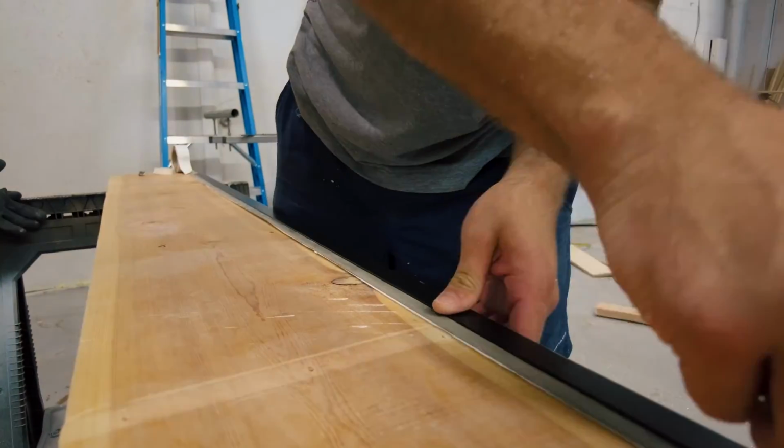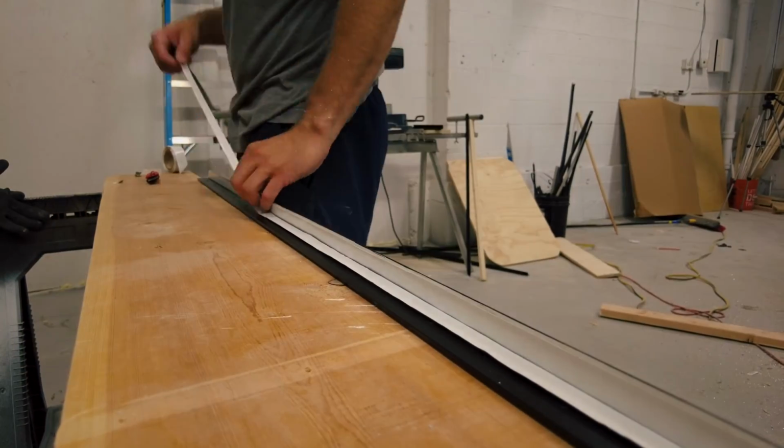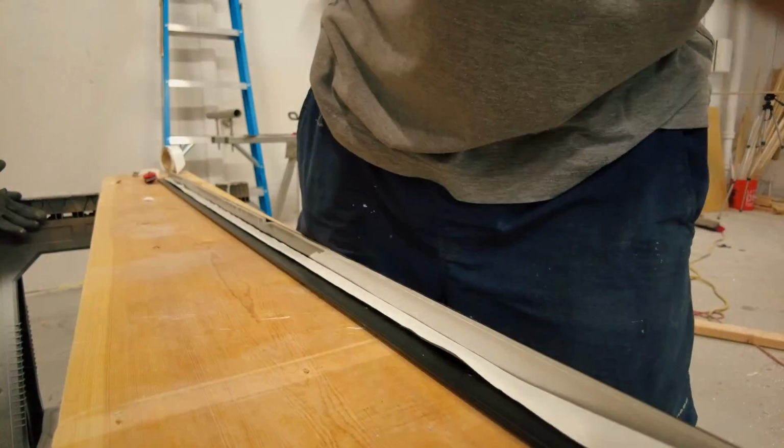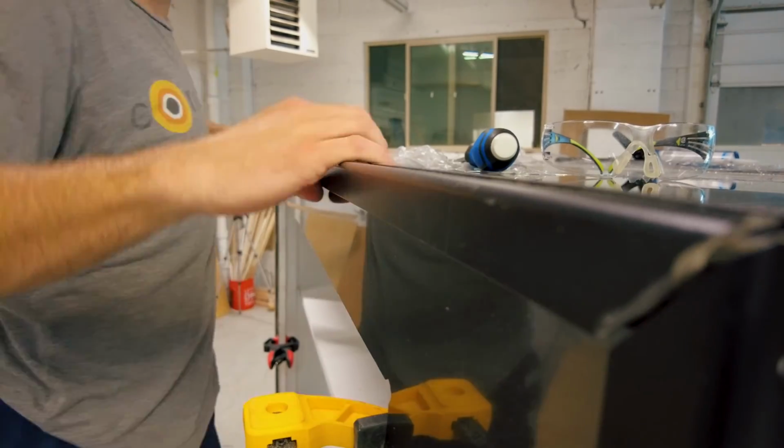Someday I plan to replace the homemade rear galley door with a manufactured side swinging door. To make it a little bit easier to pull off the aluminum and trim at the back of the camper, I use butyl tape instead of silicone, which will hopefully be easier to remove when the time comes.